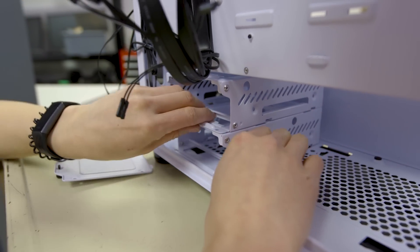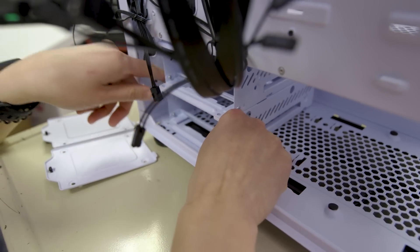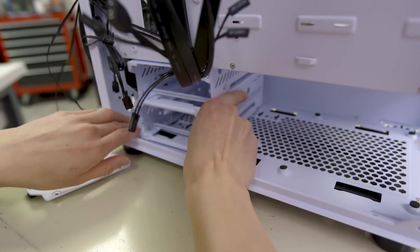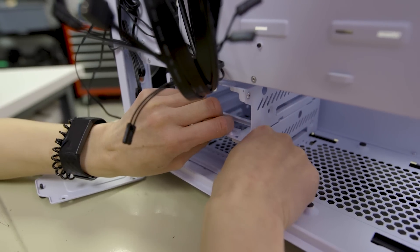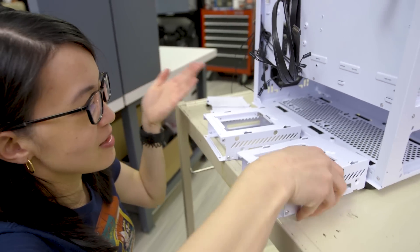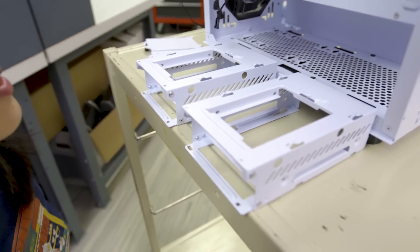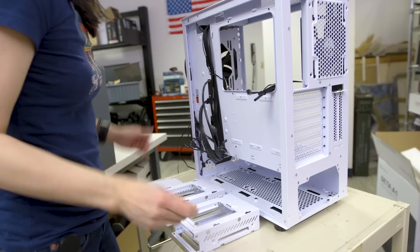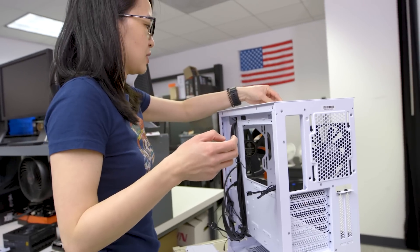I figured out how to get this out — first I want to show you the different positions where you can place the drive cage. If you need radiator clearance at the front, or if you have a slightly longer power supply, you can shift it accordingly. The way this works is it's stacked: you take the thumbscrews off, slide one piece forward, remove it, and then remove the other piece. Because of this modularity, you can also choose to have only one piece in if you don't need the extra storage mounting and would rather have more airflow or space for modular cables. After that it's just the fans and dust filter — pretty straightforward.